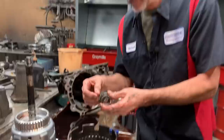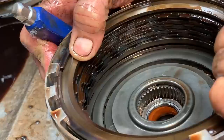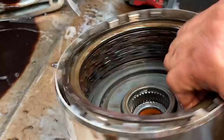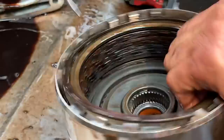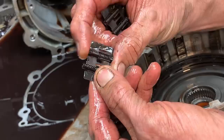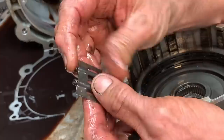Look at your sun gears — both sides of your teeth. Look at your sprags — three or four clutch is a goner, she's gone. Look how much spring load I still have on my load springs — good, really good load right there. Those three or four clutches are totally gone. You got to look at all these because you can have one of them weak, one down flat almost. The good ones are stiff — you just got to look at them all.